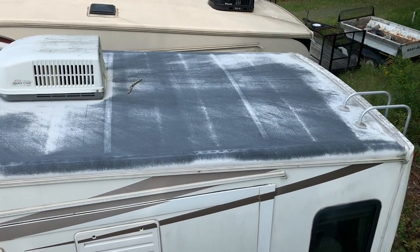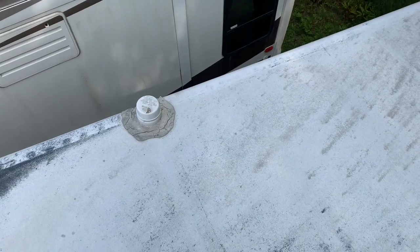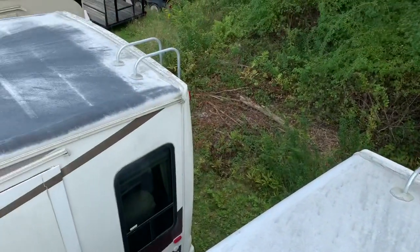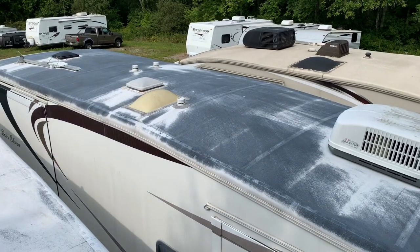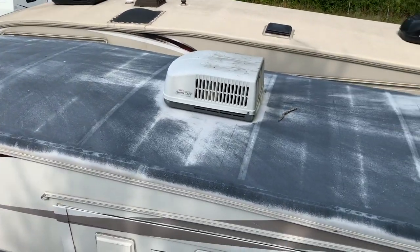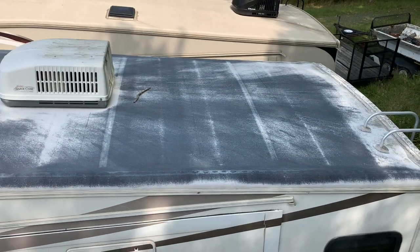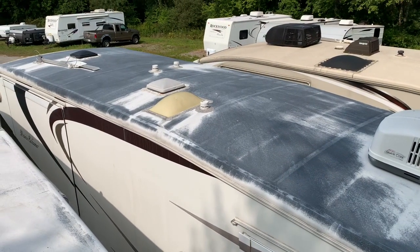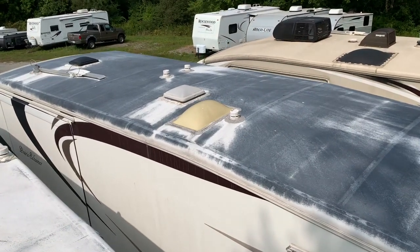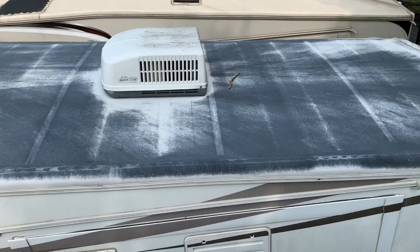The biggest thing I'd like to talk about is what to look for, when to know it's time to reseal, and when to know it's time to recoat the roof itself. The first thing that's really obvious — when you look at the unit next to us — this unit is over 14 years old, and I know for a fact that the roof has never been treated. You can tell. You can see that this used to be a white rubber roof, and what's happened is the topmost layer has worn down because of wind, sun, just getting beaten down by weather for over a decade. That underlayer is a black color, and that indicates it is time to reseal this roof. This roof should have been resealed probably two or three years ago at least.